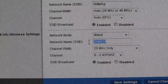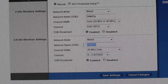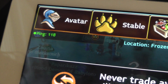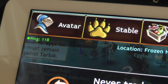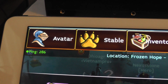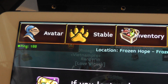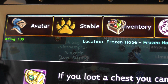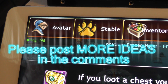I switched the security from mixed mode to WPA2 personal, saved the settings, went back and joined the network, and I've been playing for a day now without any problems. Definitely try these settings in your router. You can also reboot your router — unplug it for 15 to 30 seconds and plug it back in. The main things I did were set the Wi-Fi channel to 6 and change the security settings. Give that a try and good luck.